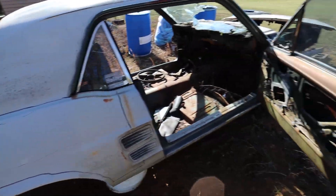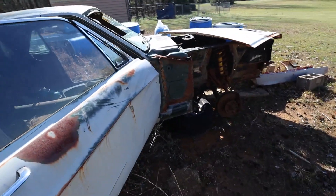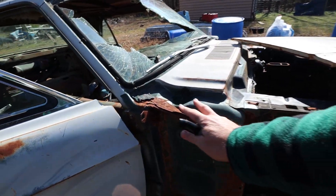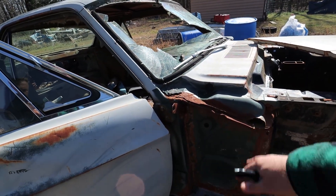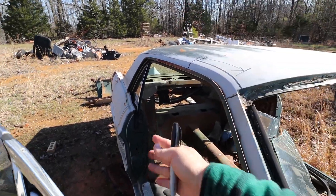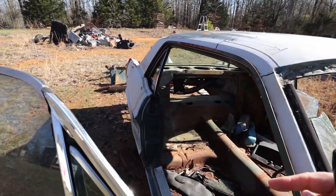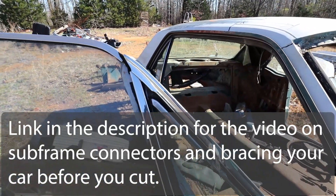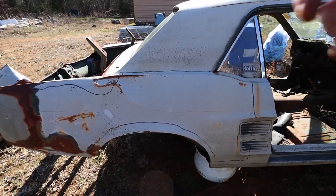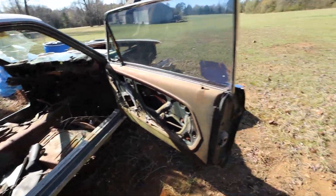If somebody wants a no-title 1967 coupe that would make a great fastback — you'd have to get a title for it — I'd sell it to you as a part. You're not going to be replacing all this lower structure. The rear quarter door assembly comes with that, but you're not going to use it — you're just going to splice it in up here. You're going to put that rear quarter door assembly in, the top will be gone, the side will be gone. I already talked in the last video about where to put your structure on the inside and where to run your bracing. Then you're going to start working those spot welds all the way around — just take your time.